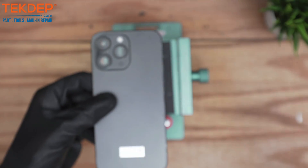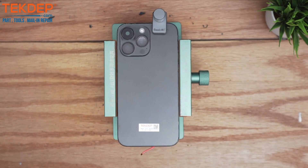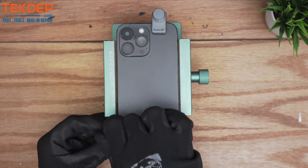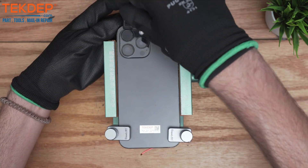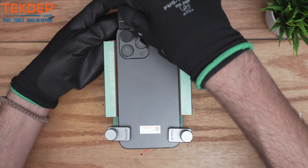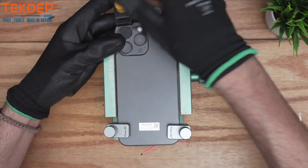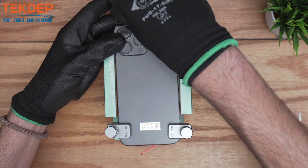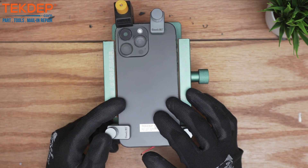Apply the clamps now. It's always good to apply just at the tip on the top left corner to make sure those weak points stay locked onto the frame, just by the tip. Add a little extra pressure just to hold it on. Let it sit for a cool 20 minutes and this phone is ready to go.